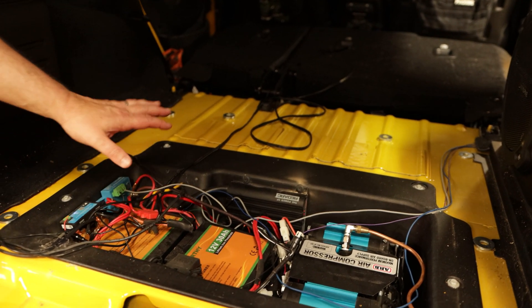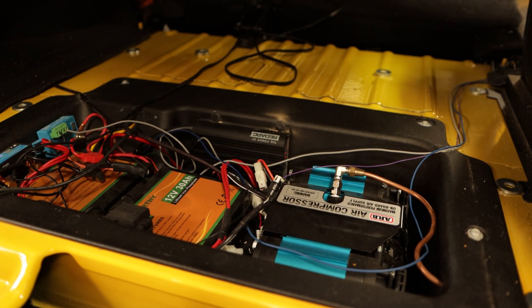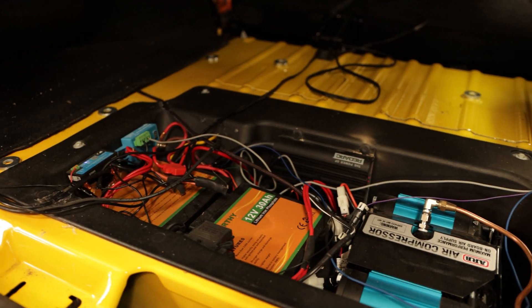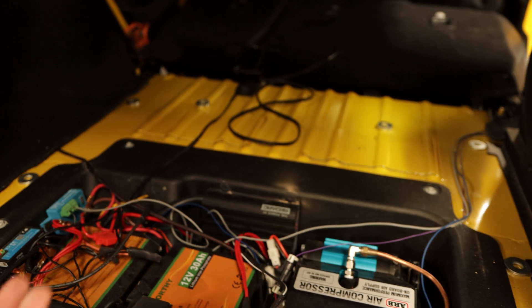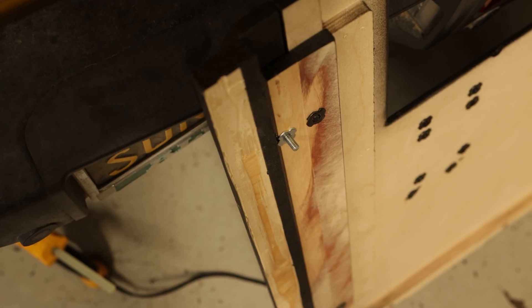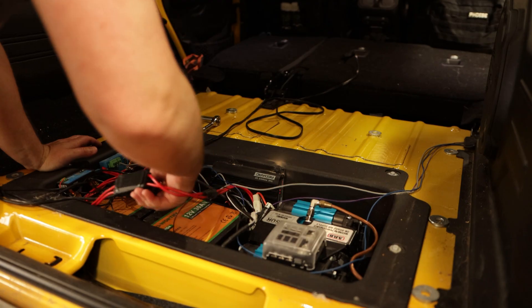Let's go through all of the accessories and what we have here. This is the standard storage tub on a Jeep JL Wrangler — there's enough storage in here for this entire setup. Right here we have the RedArc BC-DC, the eco-worthy 30 amp lithium iron batteries, the Victron battery protect, as well as the Victron smart shunt. Finally fitting in the ARB twin air compressor, which happens to fit perfectly. You're also going to notice there are washers all throughout the bed. This helps lift up the Goose gear platform, allowing all sorts of cables to fit over the tub. With the standard trim it doesn't matter, but with the Goose gear it does. One common problem with the Goose gear platform is that if it's elevated too much and you have a tailgate table, it runs right into the table and you can't close your tailgate. Separating it this way and butting the two pieces together will fix that problem.